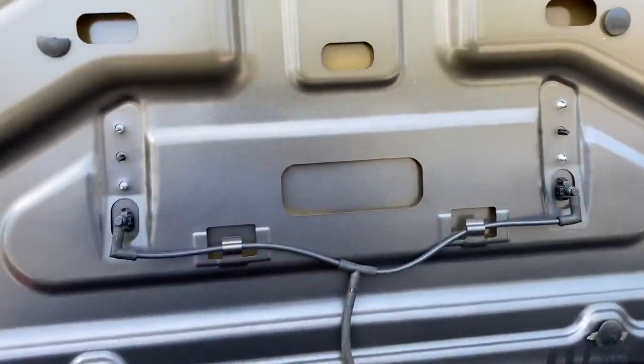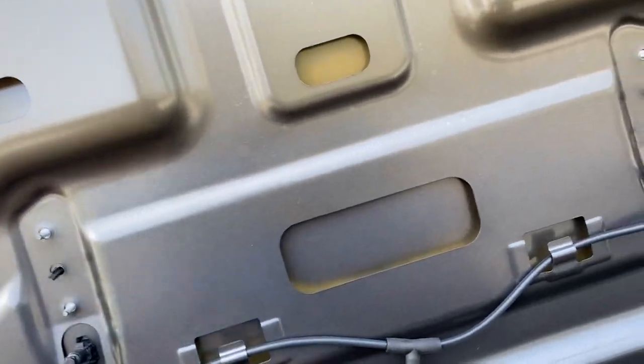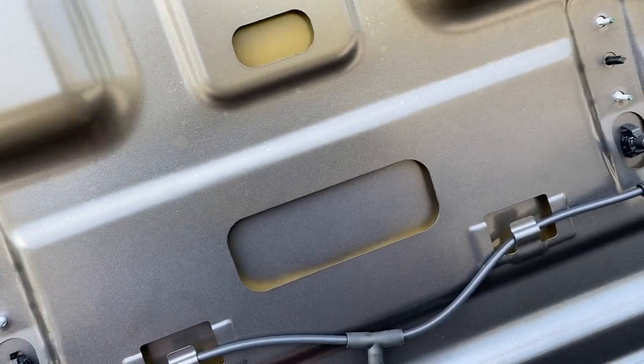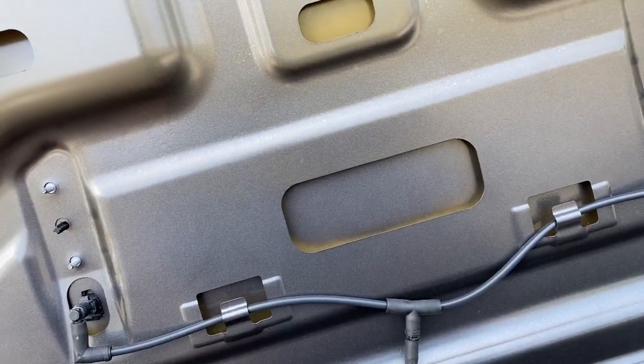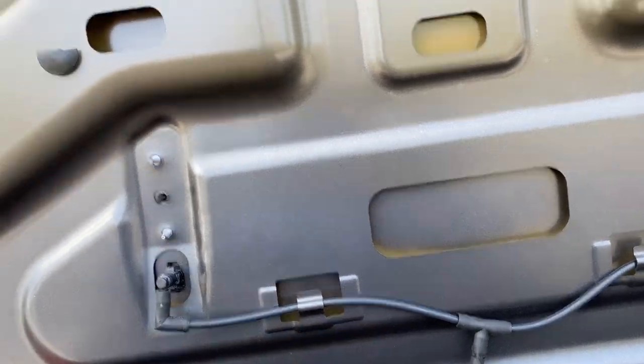The fire protection thing sucked taking off so I just ripped it — it is what it is. The good news is the parts I need to interchange are easily accessible. For the windshield wipers the bolts are size 11/32 — I don't know why the 8 looked like it would fit, but it had some wiggle. The 11/32 did it just right. Fiat taking over, you know.